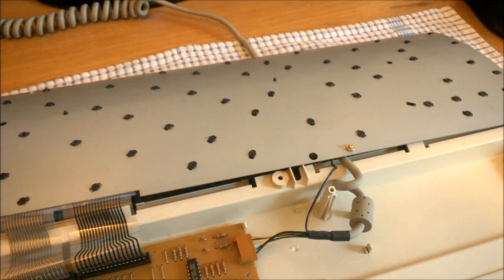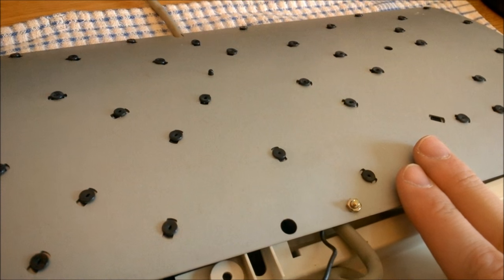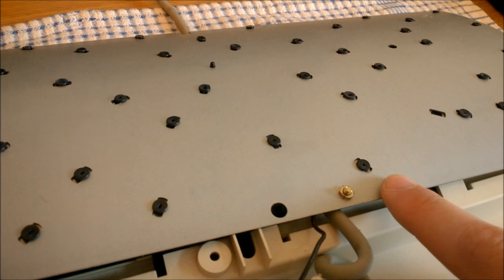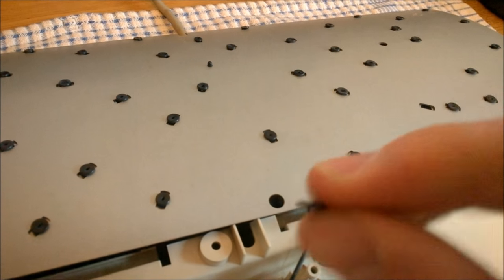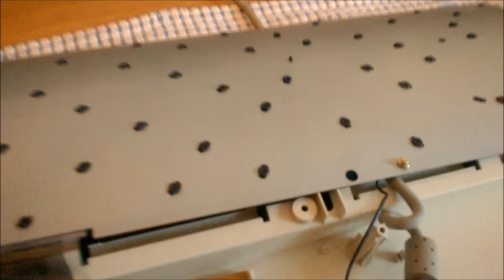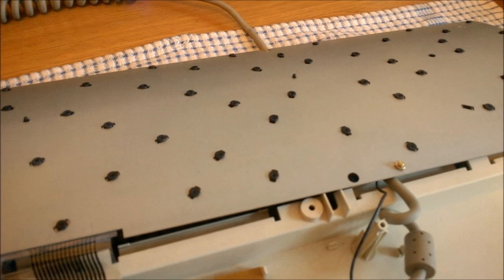Here's what it looks like on the inside. Just like with IBM's design, there is a metal back plate to hold everything together, held to the barrel plate using melted plastic rivets — there are about 55 of them. Unlike IBM's which were small and very thin and broke off quickly, the ones in this Alps board are much thicker, almost like studs. None of them have come off yet, so this seems to be a sturdier design than on the Model M.